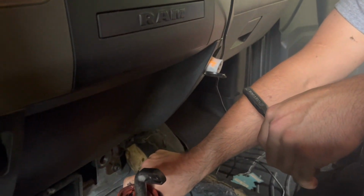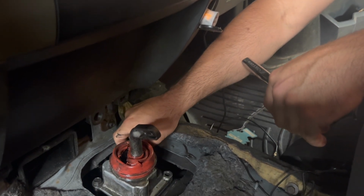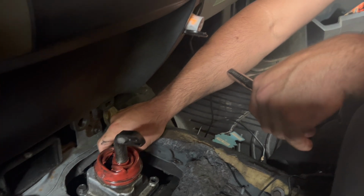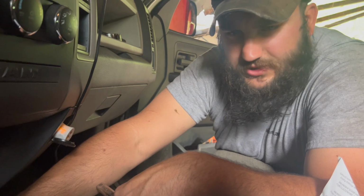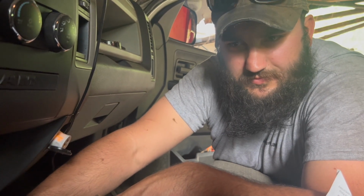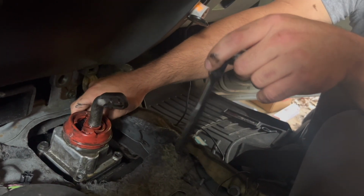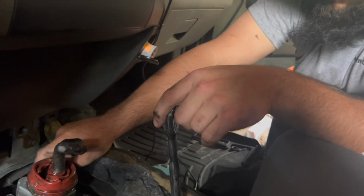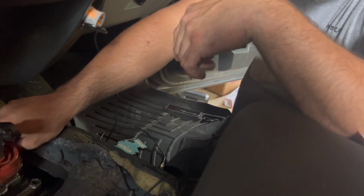The clutch got to a spot where it would bind up. It was weird. It'd catch halfway and then slip a little bit, and then it just stopped. It hung halfway and that was it. It wouldn't move. I could stomp the clutch pedal and it wouldn't do anything. I pulled over and pulled the slave cylinder off of it. I think Cody already told you I drove home with no clutch. I was just roll starting the truck or cranking it in gear at stoplights, which is not fun. I do not recommend it.